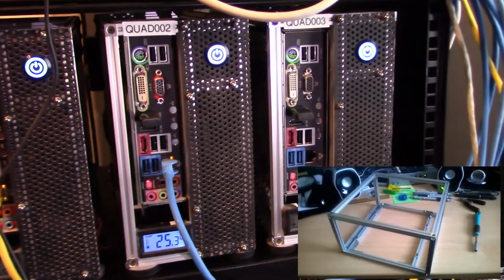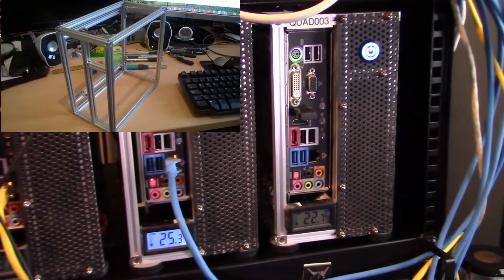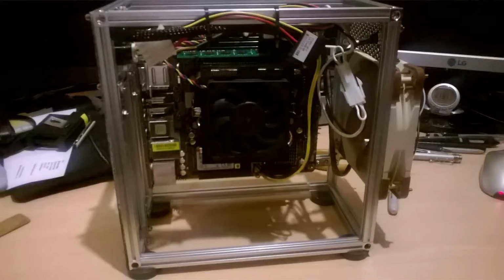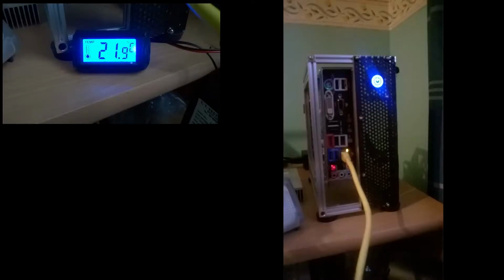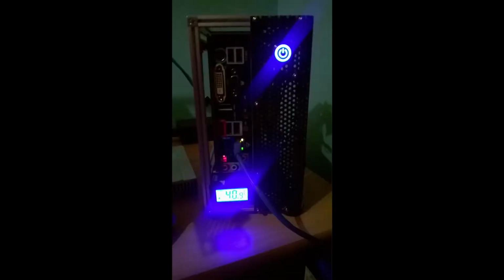The board was to be mounted in an aluminium frame of Maker Beam struts, to be large enough to support good airflow. The Ryzen processors had not yet been released, so I opted for the 4-core AMD A10-7870 processors and the ASRock FM2 A88X ITX motherboard. This did have the advantage of having an mSATA slot on the motherboard, which contained a Wi-Fi card, which I removed and replaced with a Toshiba 256GB mSATA card. This cut down on the internal cabling.